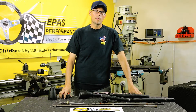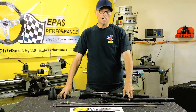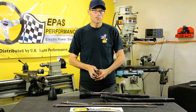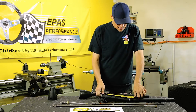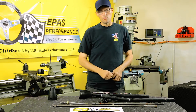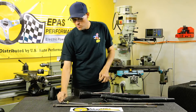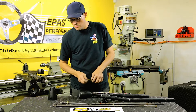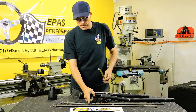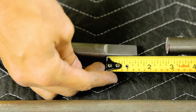Now that we have the steering column disassembled on the bench, we will need to make our first cut on the steering column itself. The first cut is ten and three-quarter inches down. Once that is cut, we will go to the steering shaft itself, and then measuring from the splines, you will come down nine and a half inches and cut there, and then you'll double-D up an inch and a half.